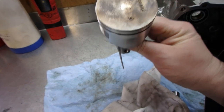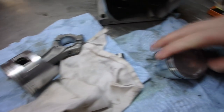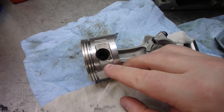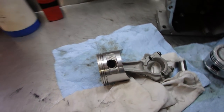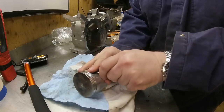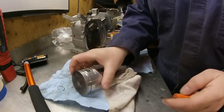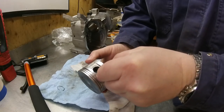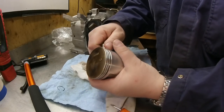Notice the little notch on the piston — a little circle. That has to go down because that's the way the piston is. Same with this one here. The first thing we've got to do is take that little ring out and get that piston out. Remove the one clip and you can push the wrist pin out through that side and the piston will just come off. To assemble it, you do the same but in reverse.